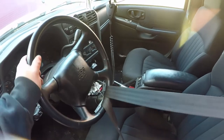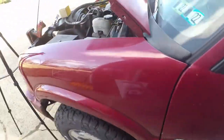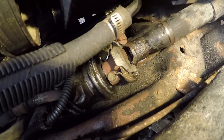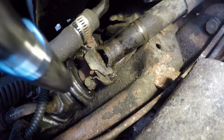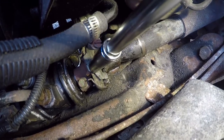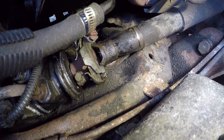My steering wheel doesn't lock for some reason, at least I've never had it lock. So put your seatbelt through the steering wheel to keep it straight — that's how you can also lock it. Come in here, cover is removed. Right there, it's kind of green in color. There is an 11 millimeter bolt right there — that's the locking bolt. It not only crimps down on the coupler to hook into the splines on the gearbox, but there's also a groove in the input shaft of the gearbox.